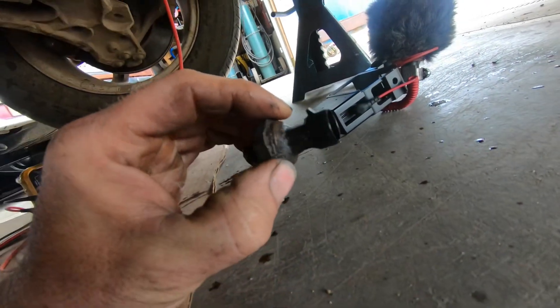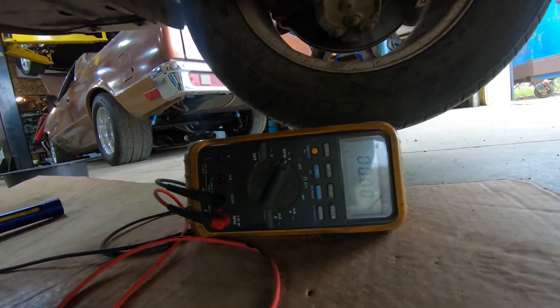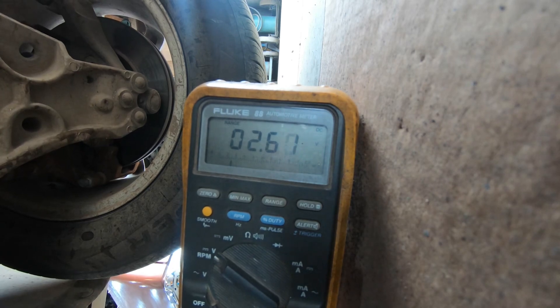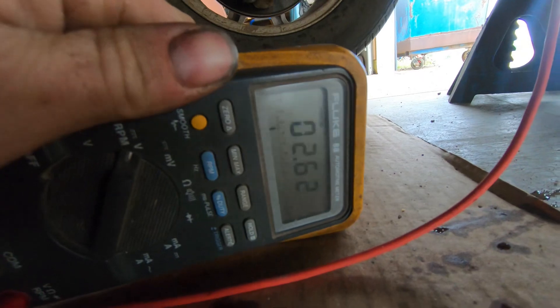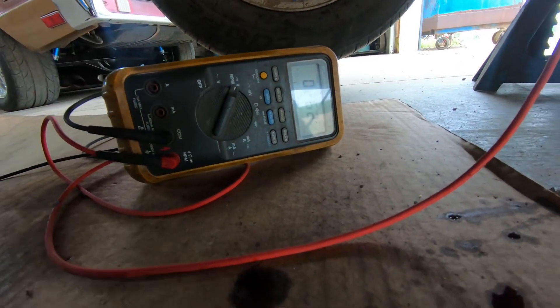Here's the old sensor - it was clearly leaking through the head unit. We have the voltmeter back up there reading zero because it's not running right now. I'll go ahead with key on the vehicle and then start it up so you get the chance to see the difference. Now we actually have a volt reading. It's showing 2.5 volts, which tells me it's probably reading about 40 psi because typically they're 80 psi sensors - it might be a 100 psi sensor. Either way, 2.5 volts, that'd be roughly 40 psi, so we are good to go on that front.